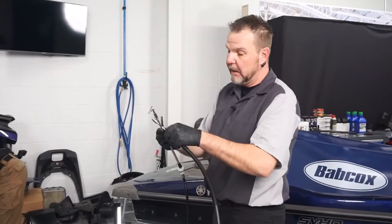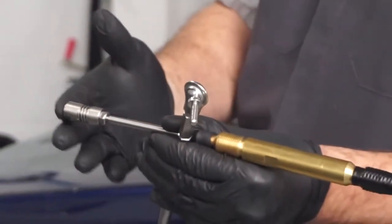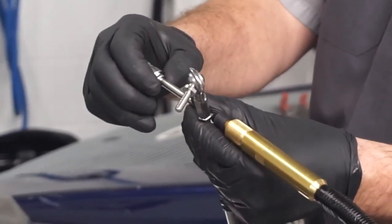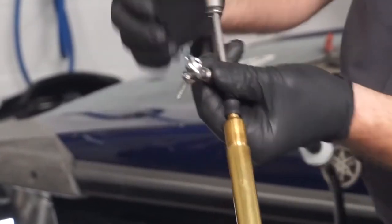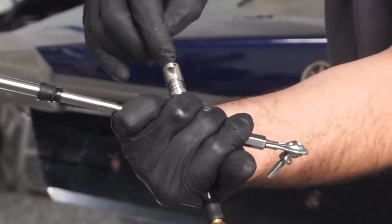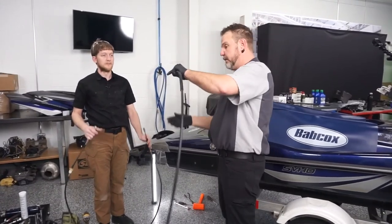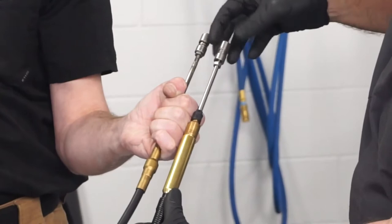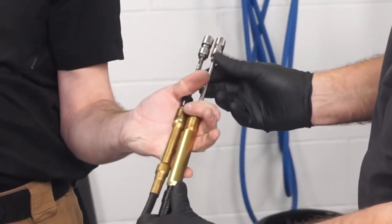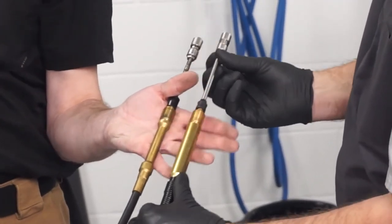You have two adjustments on this steering cable just like on the trim cable: one adjustment down here and one up over here. We're going to use the old cable as a reference setup point for where to set these. These are also your pivot points here — a good place to put some marine grease when you put this back together. I'm going to put some inside here before putting it back on as well. We'll do that when it's all routed and in place. Using the old cable as a reference guide, I want to get it relatively close — we'll check everything once it's all back in place.